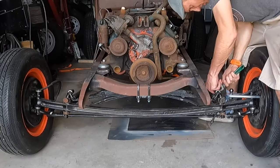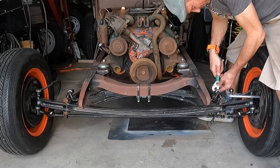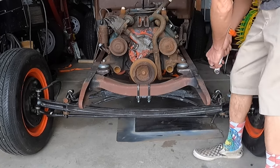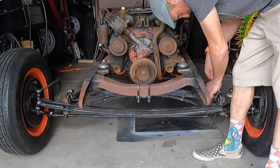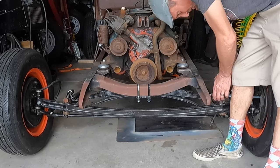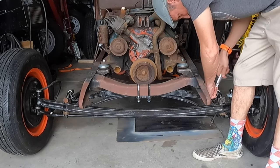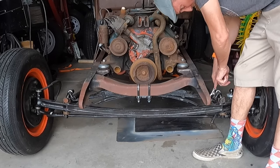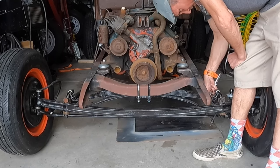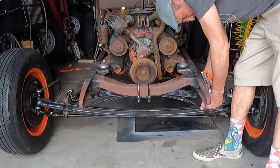In the meantime let's get these off and out of the way because they're gonna have to come off. Using the right side of the wrench will make this go a lot faster. We're gonna back those out to where the end of the castle nut is even with the threads. We can use a dead blow hammer to kind of get the shackles started out. I got a feeling they're just gonna want to come out super easy because there is some tension on here.